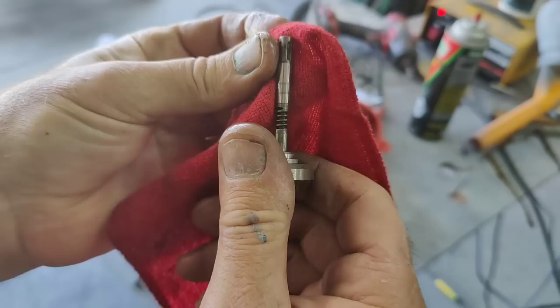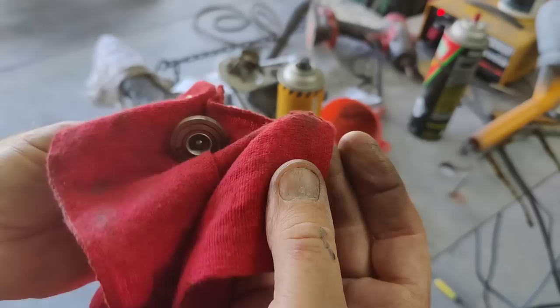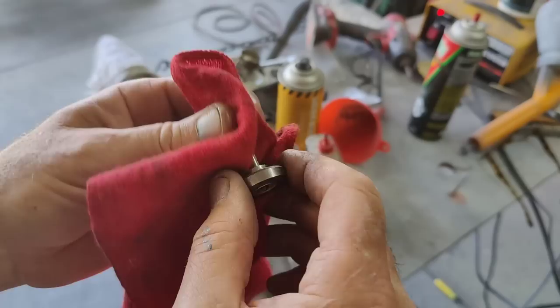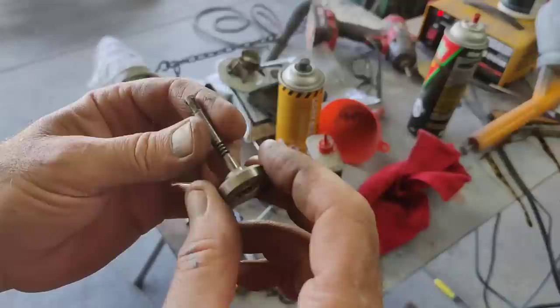And it did somehow. So I'll grease this shaft, and I'll also add some 3-in-1 oil to it. Not too much, just to kind of thin up the grease a little bit. Give it some lubricant, better lubrication. And put this back in there, and then push this little thing back in there, just gently hammer it back in, and that should take care of the problem.